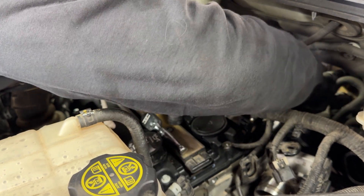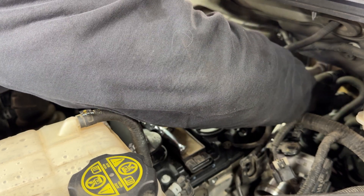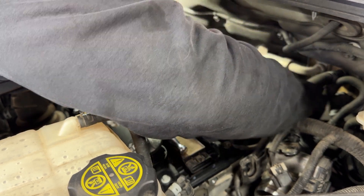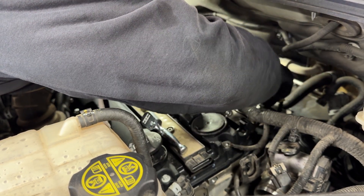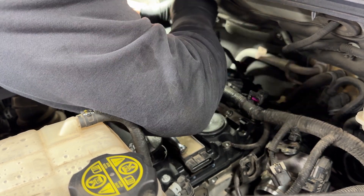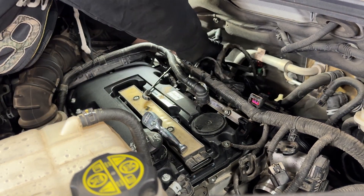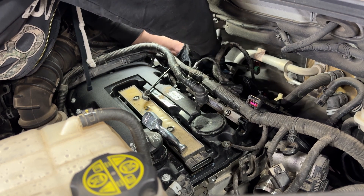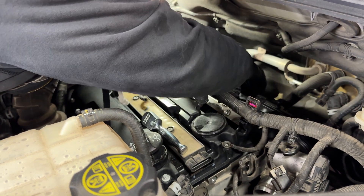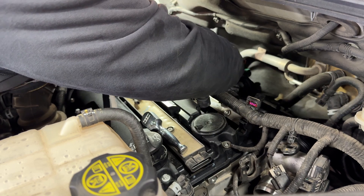Get the first threads on all the screws before tightening. With this job you usually want to replace the valve cover and intake at the same time. When you removed the hard plastic vacuum line on top of the intake, shine a flashlight in there to check the orange check valve. If you can't see it, go ahead and replace the intake. If you can see it and it's just a little dirty, you might get away with just replacing the valve cover, but if not you'll have to replace both eventually.